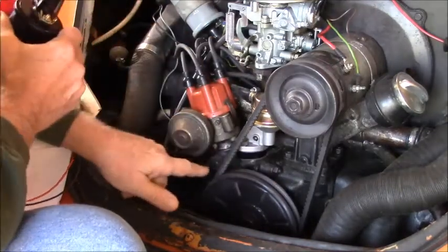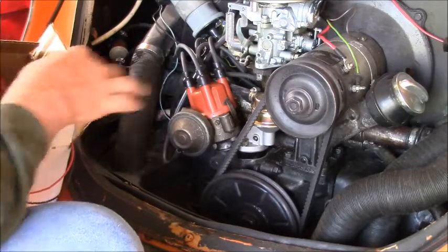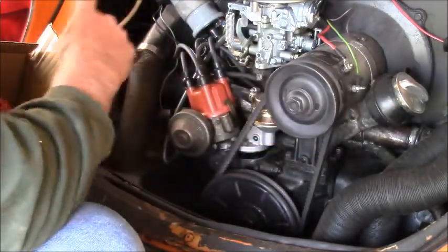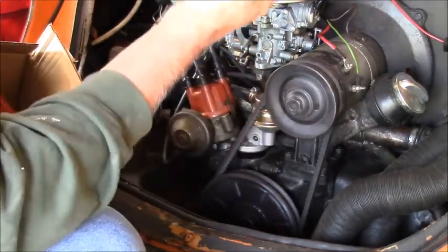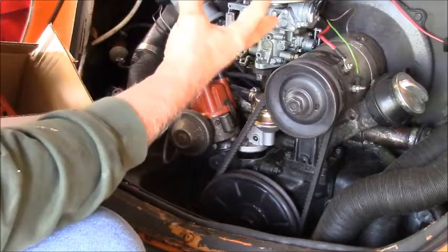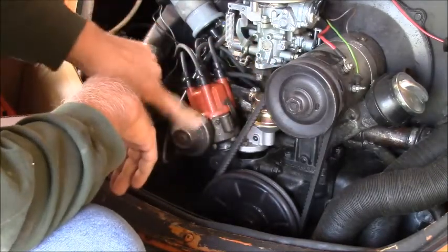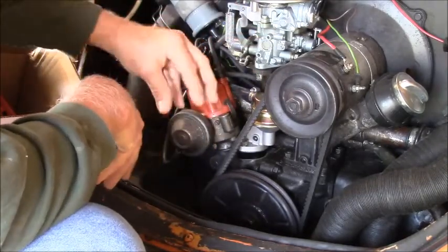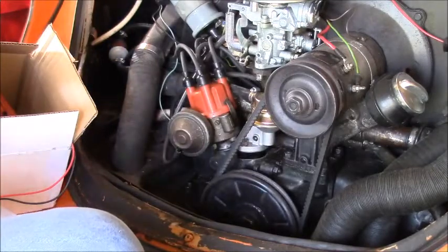Now to do that, there's a cam driven off from the engine here. I'm not sure if it's on the camshaft or if it's on the drive shaft — I'm not sure of the mechanics inside of this engine. But it's turning that distributor so that it coincides with each cylinder as it fires. To change the timing, you want the spark to fire slightly before it gets to top dead center where it's compressed the fuel, because it takes time for that spark to travel and for the fuel to ignite and start to expand. So that's called advance — you fire the spark in advance of top dead center. That's why you have vacuum advance: as the vacuum changes on the engine, this diaphragm in here moves the internal parts a little bit to change that timing to correct for different RPMs. I hope you find that somewhat helpful.